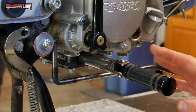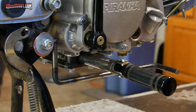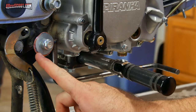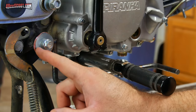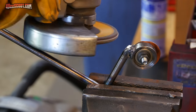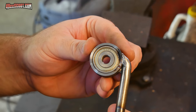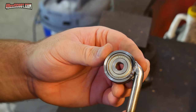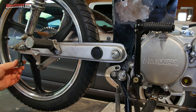This position works pretty well for me. It's out of the way of my feet so I can sit naturally when riding, but I can also get to it very easily to use the lever. I'm going to take this off and put a better weld on there. By the way, the thing you saw me making on the lathe was this copper washer - really a copper shield. I made it quickly to shield the bearing area because I definitely didn't want to grind anything off a precision machined surface. So I made that copper shield so when I weld, it can't get into that area. Note that there's discoloration on the bearing from the welding - this bearing will be replaced before final installation. It's not a good idea to put that kind of heat into a bearing.